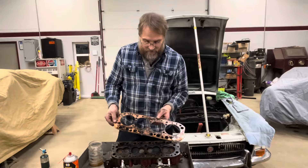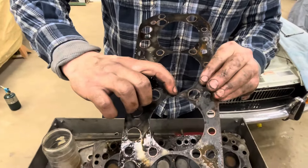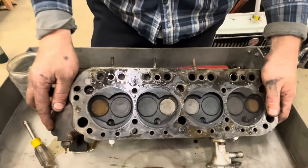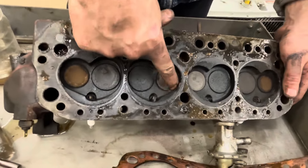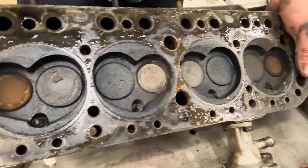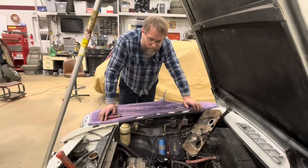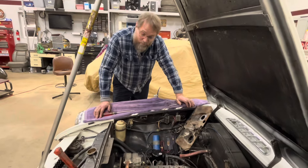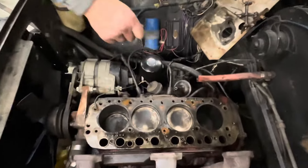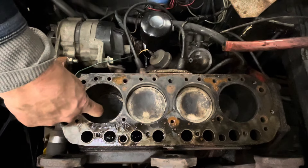With the head off, the cylinder head gasket is not showing that it's burnt through like we expected to find, but we do have some serious valve recession. We need to pop the valves out and see what we've got — probably a ton of valve leakage bleeding across. This engine has obviously been rebuilt at some point — it's got 30-over pistons in it. The good news is there's no big damage in the cylinder wall.